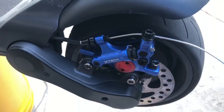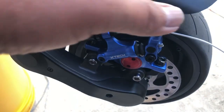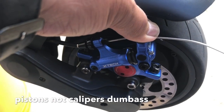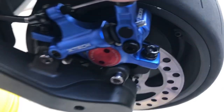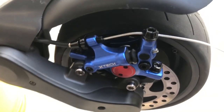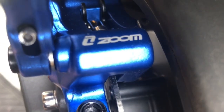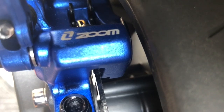When you're adjusting the entire assembly to be centered over the disc, go ahead and pull this forward so that both calipers come out and center themselves on the disc. As you're holding that, tighten down the screw there and the screw right back here. Once you've done that, release it and you should have the perfect spacing on the back and the front pad. Right in here directly above the Z, your disc is in that little archway.